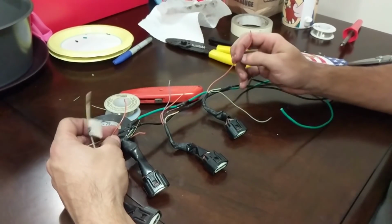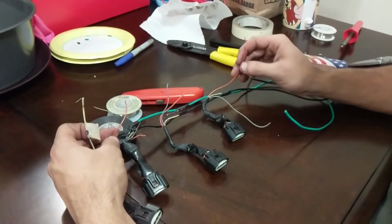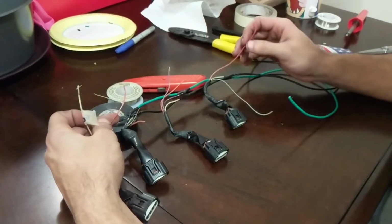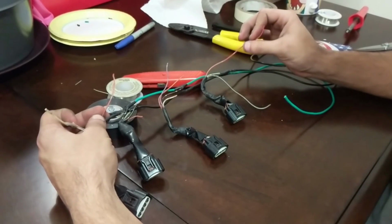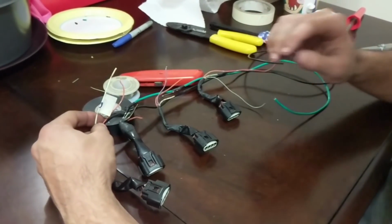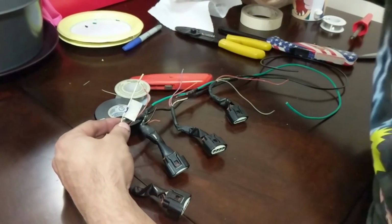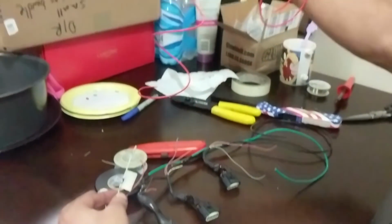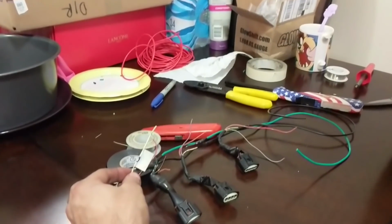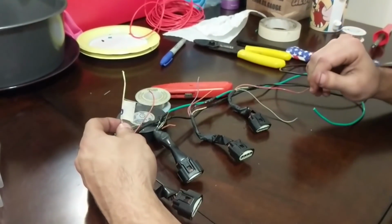Apparently that's used more on the OEM side of things. For aftermarket ECUs, they don't really need this. I thought it was a trigger wire positive and then a ground, but looks like we can just chop off these red wires really short and make sure to insulate them so they don't ground out on anything. Basically that's it, and then we'll have these run into the cabin on their own separate wiring, which is what all this is for, to run into the cabin and over to our ECU, which we don't 100% know where we're mounting yet, but we'll figure it out later.